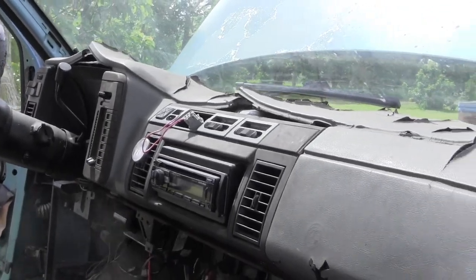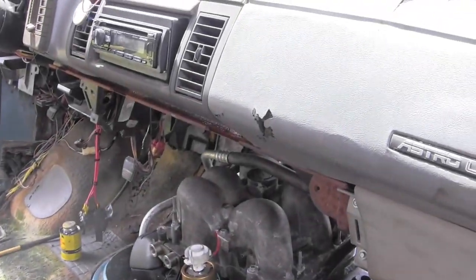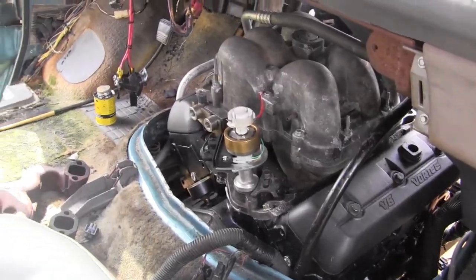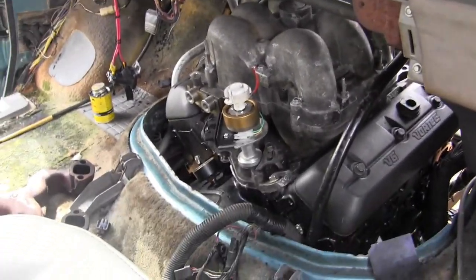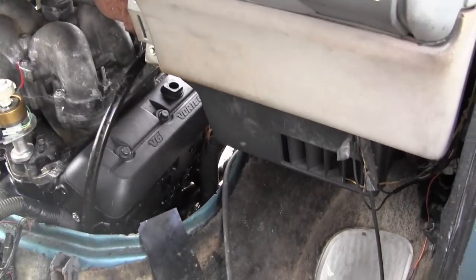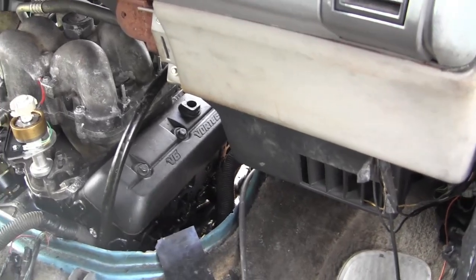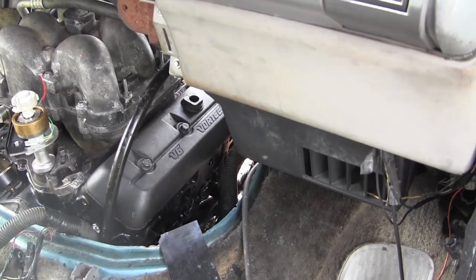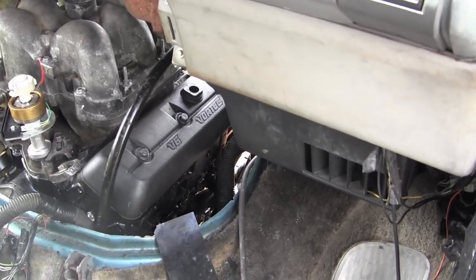I'm having a lot of fun with this now that I've got the physical part done — I've got the engine in the bay and the engine mounts done. Now I can get into the technical: the sensors and the wiring. I do have a spare PCM I got from a salvage yard, and I've swapped the firmware chip — I know it works. I probably should get another firmware chip so they're hot swappable without having to move the chip every time.